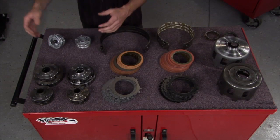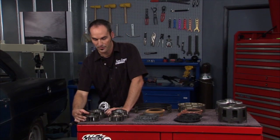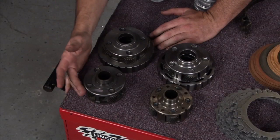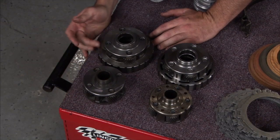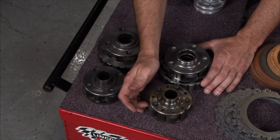Welcome back. I've got some of our transmission internals laid out. You can see some of the upgrades that Monster does — they pretty much touch every single part and give it an upgrade. You can see these two planetary sets, the front and the rear. The original has a four-pin, four-gear planetary for both front and rear. What they've done is add a fifth pin and extra gear set.